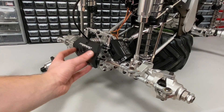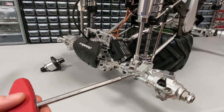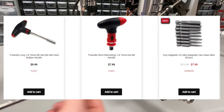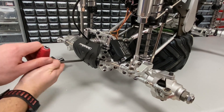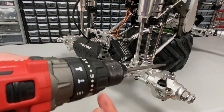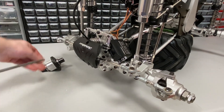I'm going to start by removing this front bumper cover. I'm going to be using a variety of tools, but they're mostly going to be four millimeter and five millimeter, and I think there's a few threes and 2.5s. We sell these T-handle wrenches on our website along with the bits. They're some of the best tools you can have for working on a truck this big. What I usually do is I'll break all the bolts loose with a tool and then I'll use a drill to get the last bit out. Something to help prevent stripping bolts is on your drill you can set the clutch to be really low — I have it at nine — and that just prevents applying too much torque so you won't strip out your bolts.